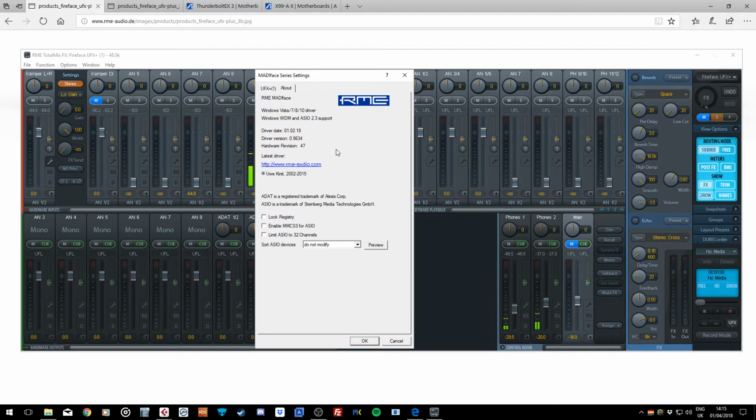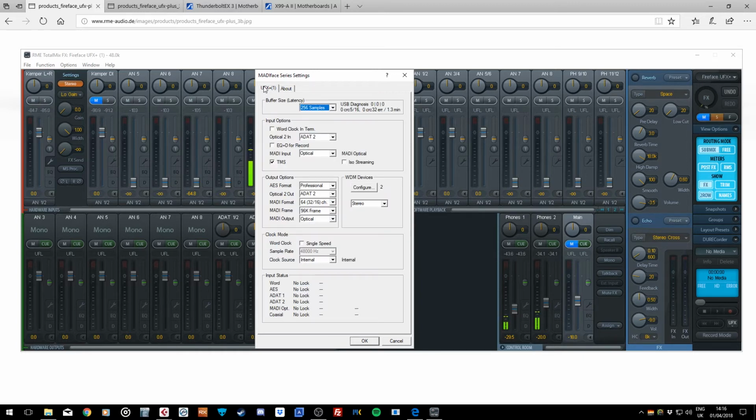This is latest as of first quarter of 2018. So obviously this is a Thunderbolt and USB 3 interface. At the moment, I'm running over USB 3. I was having some problems with Thunderbolt. Basically the problem was that I was getting intermittent bit-crusher, distorted-type audio under Windows audio, not on the ASIO side. So everything in DAW playback was fine. It was just the Windows side.